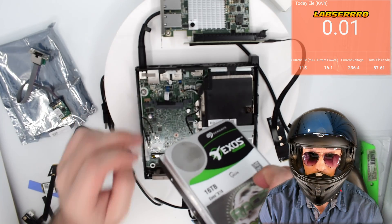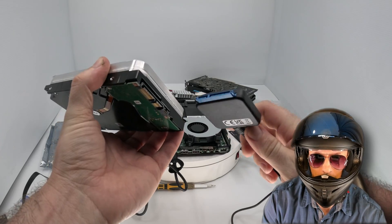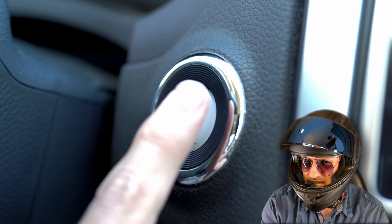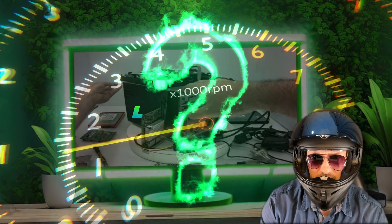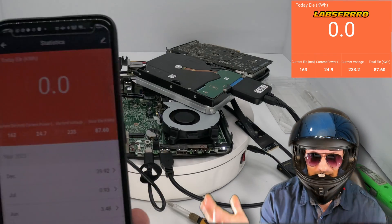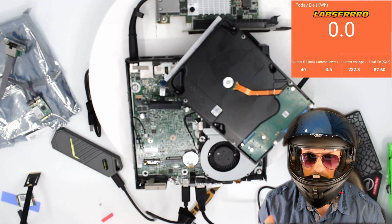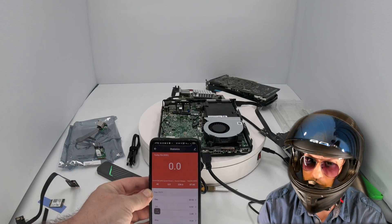Of course we can - absolutely no trouble, though you will have some problems with installation. We'll use one of these DC cable connectors, plug it into USB, and connect it up with DC power. There's the power draw for this hard drive - we're pushing around 20 watts, maybe up to about 37 or so watts when this drive is spinning at full speed. That's actually quite a lot of power, but it does confirm we can use external DC power to keep the hard drive spinning, which is pretty cool.